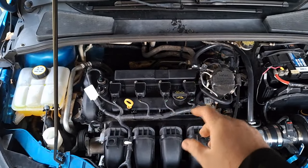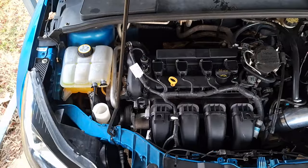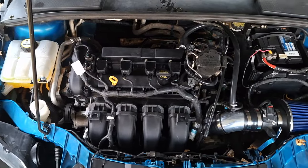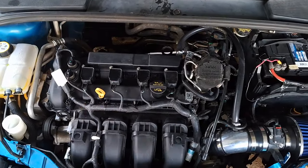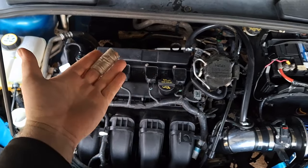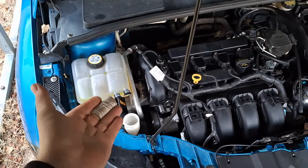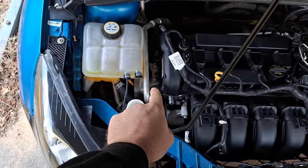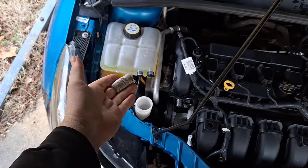Moving on to engines: the 2-liter naturally-aspirated Duratec engine, paired with the dual-clutch transmission, is an outstanding rock-solid reliable engine. About half to three-quarters of them will seep oil from the front cover — don't worry about it, I haven't seen one leak bad enough to cause the oil level to get low. However, the valve cover gasket is going to leak; it's a quirk of these. When the valve cover gasket leaks, that's a good time to replace the spark plugs. To bulletproof the 2-liter Duratec, you can also replace the water pump, replace the upper engine mount — that's going to wear down and vibrate — and replace the degas bottle with an OEM degas bottle. Don't use Dorman; they don't machine the ports correctly and can cause pressure loss in the cooling system and overheating.